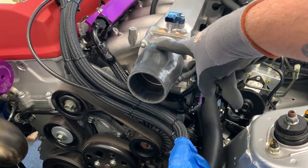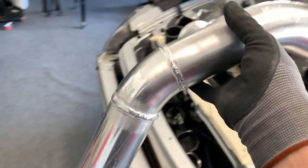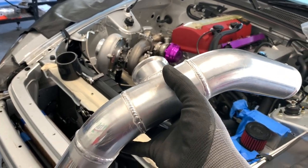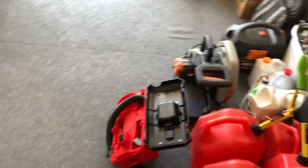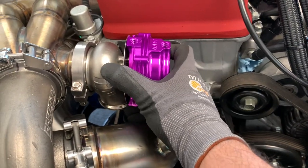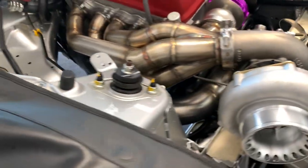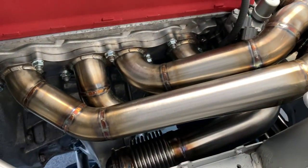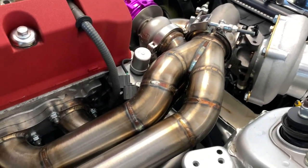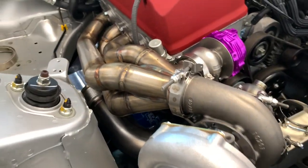So today getting the charge piping with the final fit. I did all this myself, so saved a lot of money. That weld right there was pretty rough — that was early on. Got the wastegate on yesterday, it's not fully tightened down yet because we were testing fitment with a dump tube. This is a Straight Line Motorsports kit — their manifold, which I think is phenomenal, it looks absolutely fantastic. Obviously once we start running it we'll see how strong it really is, but I don't anticipate any issues.